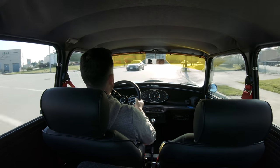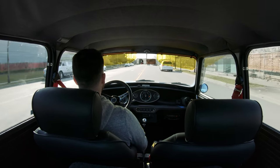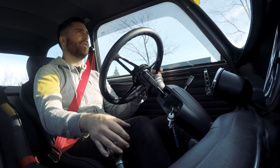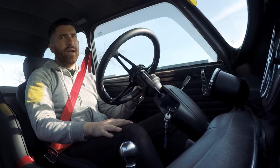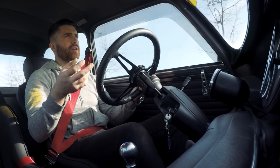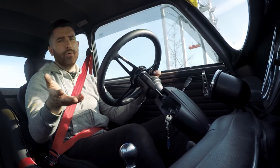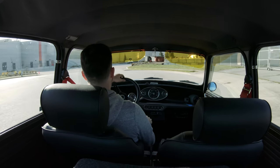Now we're starting to get some heat in it. This car feels great. The suspension setup we're running is our pretty usual package — we've got red spot cones on all four corners, hi-los, adjustable control arms front and rear, and KYB AGX shocks. Right now we have them set at the softest setting, which is the most comfortable for the street and also gives a better idea of the sway bar's effects — any roll resistance you see will be coming from the sway bar.